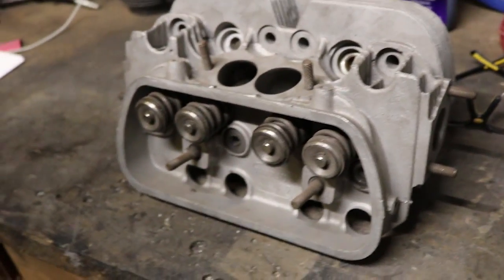After the heads — plans for lifters and pushrods: I'm going with chromoly pushrods. I already have my lifters. They're in a box up there with my deep sump. Running a deep sump — a big one — which allows for more oil. For the rockers, probably just swivel foot adjusters. We'll see all that when we start actually putting the motor together. Right now I was just worried about the big pieces: case, heads, crank, rods, cam, et cetera.